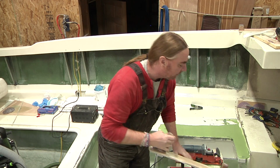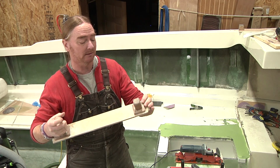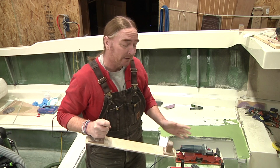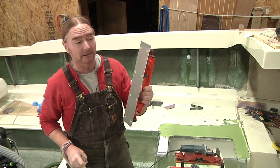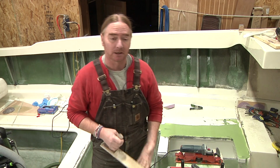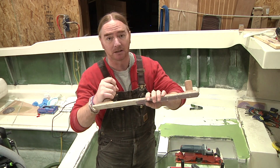But you don't have to buy these fancy things. You can still DIY, for the most part, a lot of these things that you need for doing a good fairing job. The one exception, as I mentioned, would be when you're applying the material. I do think that something like this, for applying it, is worth the money. As far as sanding, if you're on a budget, something like this will work perfectly fine and get the job done beautifully.